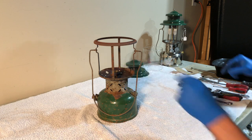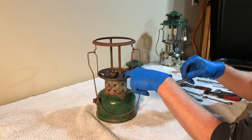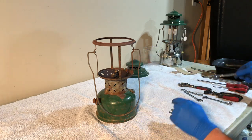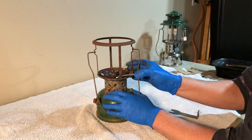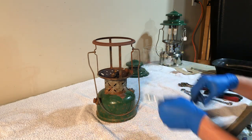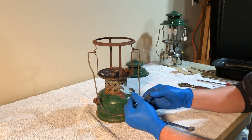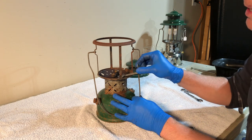Before we take the upper part of the valve off, the tip cleaner assembly, we need to at least loosen this nut. We can probably take it off without that, but it'll be easier. Now this is a 9/16. I've got a 9/16 wrench here, and now with everything off, that'll go on there, but you may have trouble. You may not have a 9/16 that'll get down there at the right angle. Some folks actually will make a bent one. So if you've got the wrench from a 530 pocket stove, or a mil-spec wrench, those are actually designed for this, and that'll go in there too.